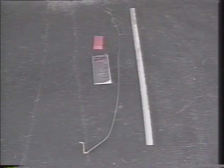This is a look at the Z-Tool set. This set uses one main tool to open about 600 different models from the 1950s through the present. The tool is augmented by a couple of plastic wedges, a window spreader, and a wooden stick to help hold the window open. The secret of the Z-Tool is to look the type and model of car up in the book, refer to the diagram for its particular type of locking rod, and then apply it.